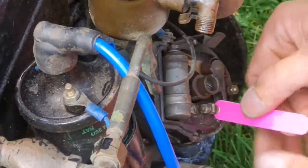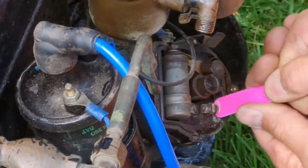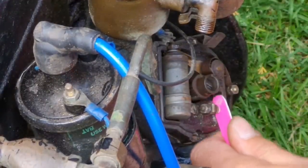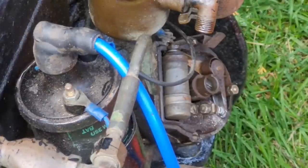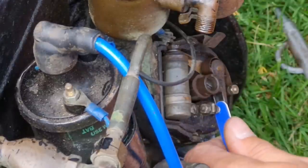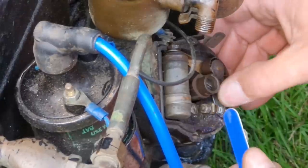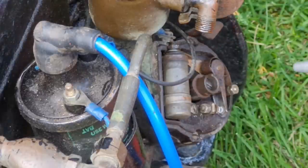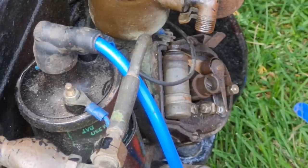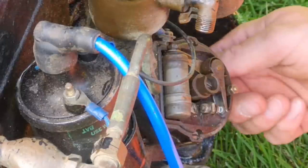God, they are corroded. We weren't going to get much spark out of them. So we use the old woman's nail file. Mrs. Mancave will love me for this. Give them a good sand up. You know, I think this is looking hopeful. Shall we just bang the plugs out of this and see what they're like? I do think we need to put a little bit of oil down that distributor shaft, because this thing hasn't turned for so long. Just a little bit of routine maintenance.